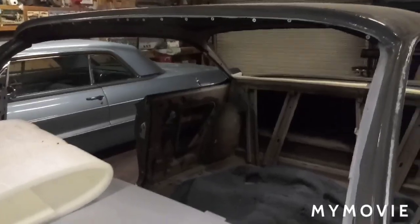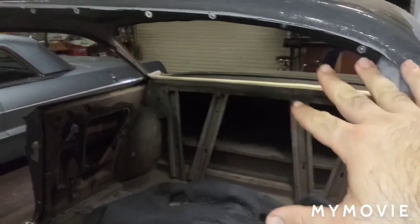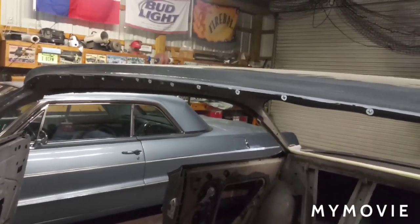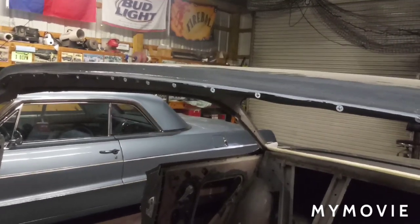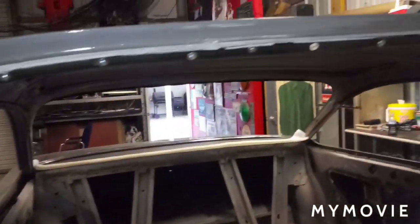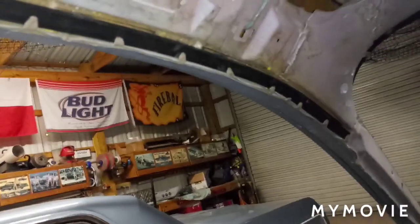Three hours later — I had to make sure the flash was on — I got all the tack strip in place. The process: you take the old strip off. In this area there are about three screws, and in the rest it's steel staples that staple it to the roof of the car, which are tedious to remove — that takes most of the time. Then I went back and drilled holes and put sheet metal screws to hold the tack strip all across the front. You also have a section for the rearview mirror you have to allow for, and I got both wind lace pieces in — that part's easy.